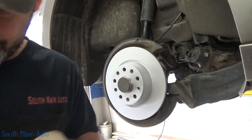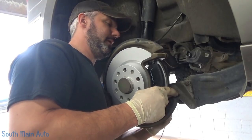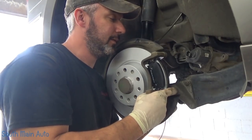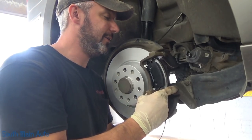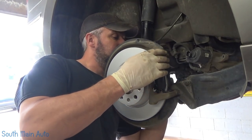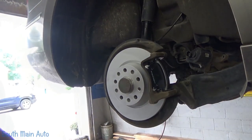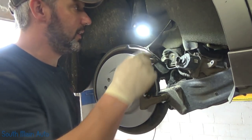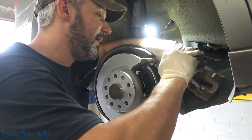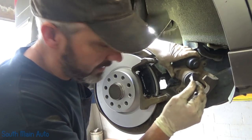These are the bolts that hold it on — that's the triple square. Give it the classic reach around if you can. Get these bolts started, get both of them in, torque them to factory specs. Once that is done, we'll lubricate our brake caliper to prevent noise and prevent it from rusting in the future. A little bit of grease on the inside of the caliper ears — you don't have to go hog wild — and then we do the face of the piston to keep it from getting crusty.